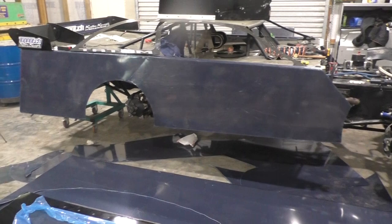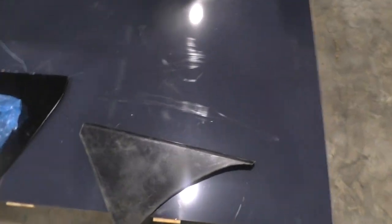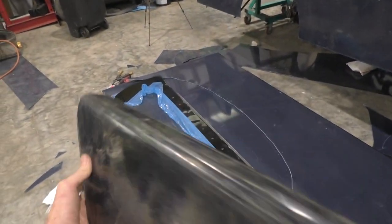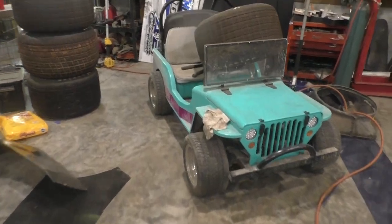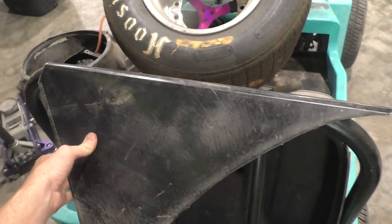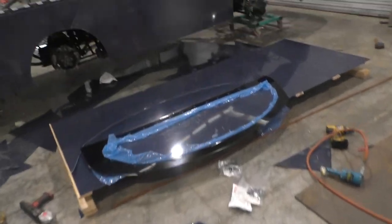Got the top of our doors and rear quarters broke. I went ahead and built us a new filler piece for the nose cone — got that ready to go. I also have the front quarters, which I've had built for a few months. You can see how I ended up getting that nice smooth radius right there — not a sharp bend, just a smooth radius. A tool I built for this is actually a quarter-scale Jeep that I built just for this. I added the door beating roll bar, and once you do your brakes on the brake, I just set it on that tube and take a little rubber mallet and beat the mess out of it until I get the shape I want. Long process, but the job gets done.